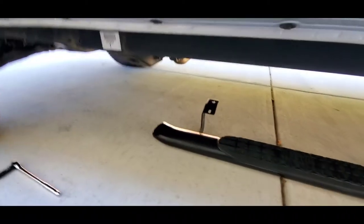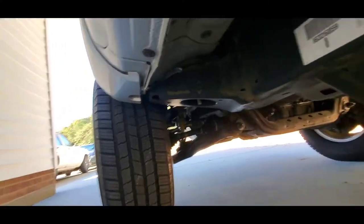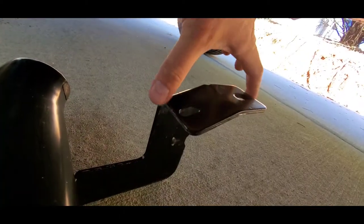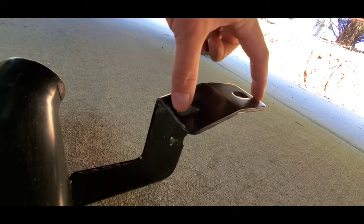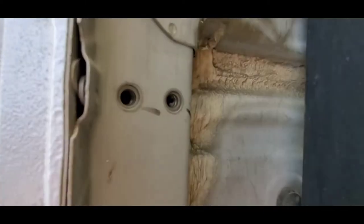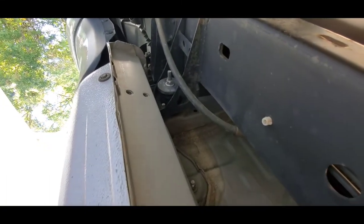The holes under here are part of the body — you're mounting into the body. The front bracket has a longer, wider plate with the bolt holes further apart, while the middle and rear holes are closer together. That's because the actual screw hole mounts at the front are far apart on the truck. This is different from the In-Fab ones I returned, where both front holes were right next to each other. It's identical on the passenger side — front holes wider-spaced, facing the front of the truck.